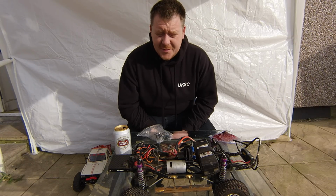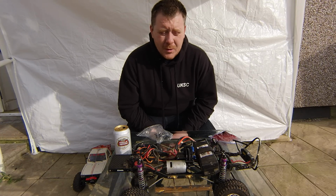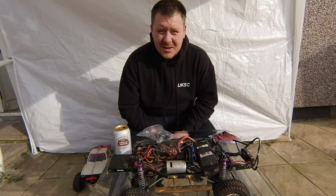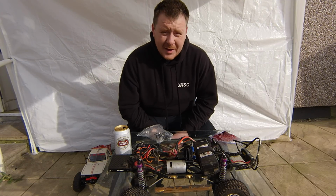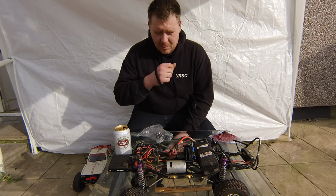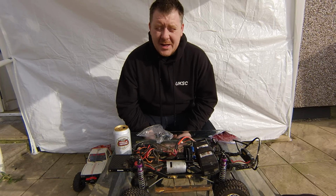Right, today's video is about gearboxes. The standard Axial tranny is not bad, but you tend to strip out the idler gear quite easily. Then people will buy a metal one, put that in, and then you strip the diff gear because you put a metal gear in. So it's the standard Axial. They said the Axial upgraded gears cost a mint.